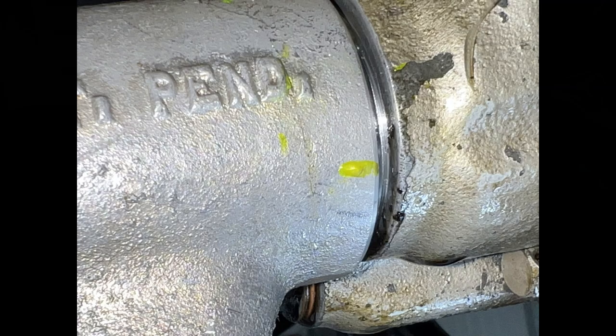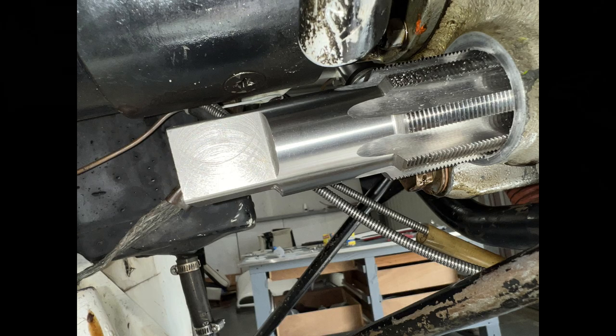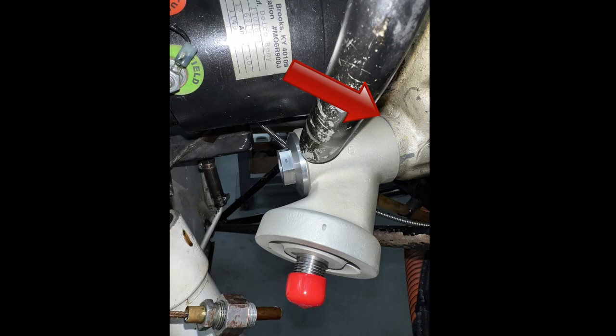But even after I cut the thread, I was still not getting completely flush — and of course that's without any gaskets. The AN gasket that goes on the end, or the new Teflon with stainless steel reinforced gasket — I still wasn't able to make it bump completely up. I was starting to believe I might have had some kind of clearance problem in the adapter itself, but that wasn't the case. So after I chased the threads with the tap, I installed the new one and you can see it's perfect — it bumped up right away.